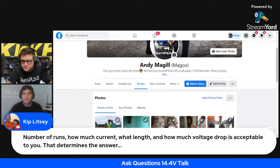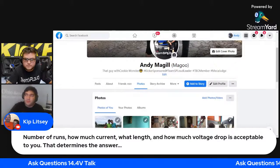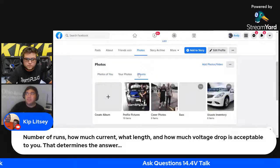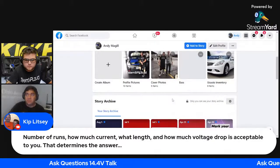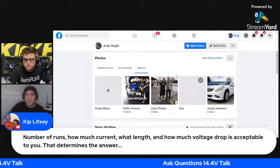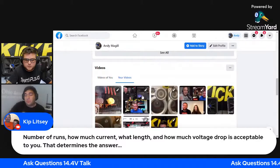And everybody now wants to run high voltage. Everybody is like, I want to run 15.5 volts, and I'm like, sorry, it's not going to work out for your application. And they go, why not? And I say, because your vehicle is designed for 12 volts, not 15.5. You will have problems with check engine lights, check battery lights, several problems running at that high of a voltage. And some people don't have problems.